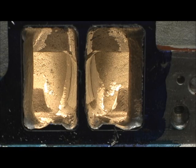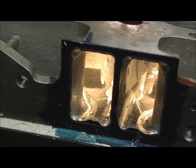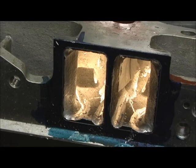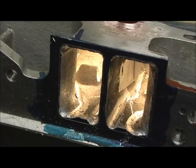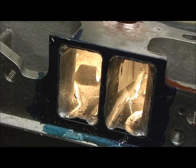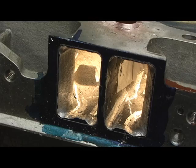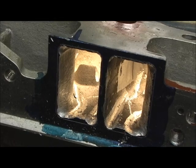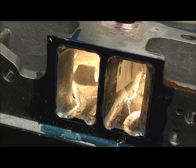All the way from the back of the guide all the way up. Let me see if I can position you so you can get a good look at what I'm doing. The real key here is getting you in there to see while I'm in here with the grinder, trying not to get my hand in the way — but it's not so easy. Notice how I try, with the grinder spinning, to keep this thing in the center without going over to the edge and hurting the walls, because I sure as hell don't want to dig any kind of trench with a burr that big.